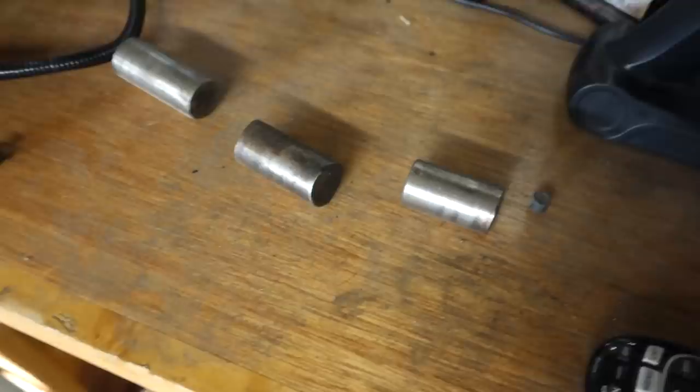So on this truck right now, it's actually getting an upgrade to 1¾ kingpins that Eric Moore makes, and those will take this to a semi-truck style kingpin. We know semi-trucks can haul hundreds of thousands of pounds or so. If it can do that, then I may not be able to break them. So we're going to try that, we'll see what happens.